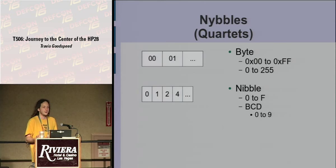All floats are held in binary-coded decimal so that the calculator makes the same rounding mistakes you would with pen and paper. That way, when you calculate something on the calculator and then do it again on pen and paper, you wind up with the same value. You have no problem representing one-fifth, which is very difficult to represent in a binary float.